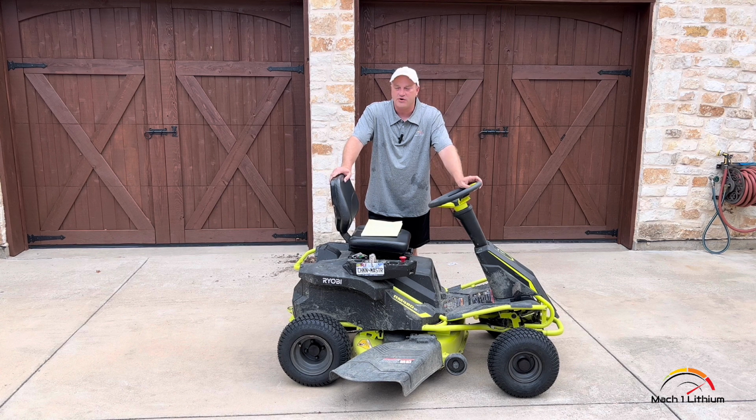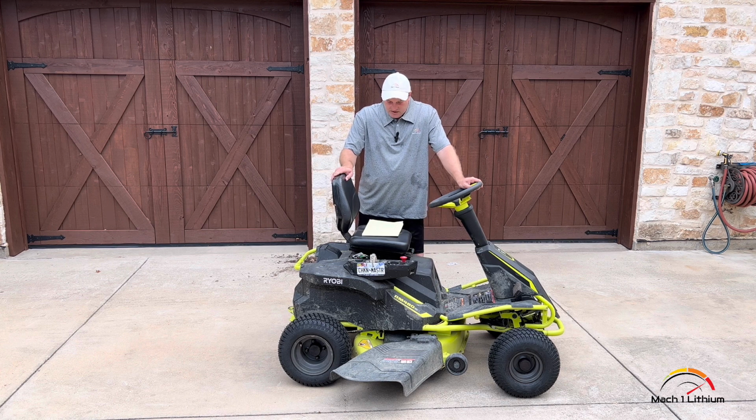This build turned out great. We basically swapped two 24-volt batteries in series for a 50 amp hour 48-volt lithium battery. The old batteries, there were 4 of them. They were 12-volt lead acid batteries in series, so a 75 amp hour battery, and we lost quite a bit of weight doing that. So really, here's the rundown of the build.